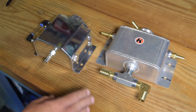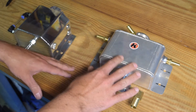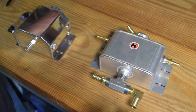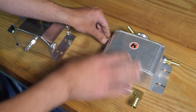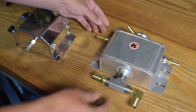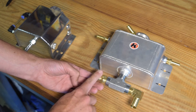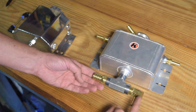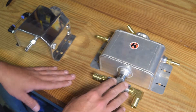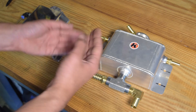We're back working on the cooling system for the LS Turbo Swap. Thanks to Hydraulic Direct — who's not a sponsor but was kind of the one-stop shop I found to get all of this in the same place, and they shipped it really fast. What I have here: this is half-inch NPT going to straight three-quarter-inch hose barb, and then to a 90-degree barb. This will come up behind the engine with all the three-quarter-inch hose. If it's surging into the expansion tank it will basically bubble up through here; otherwise it just keeps flowing.